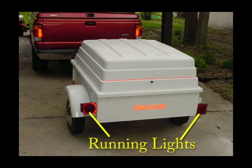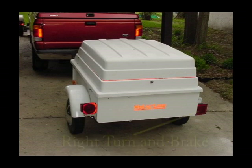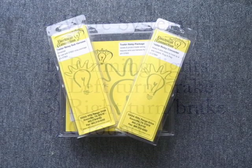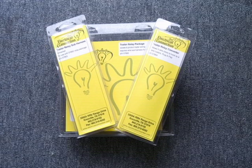Trailers that are imported, or a trailer that's designed for a car, may have combined brake and turn signals. For example, trailers from Harbor Freight and Piggybacker are 4-wire trailers — they have just one pair of lights on the back. This means a 4-wire trailer uses one less circuit, making it a little different than your bike. You can't directly wire a 4-wire trailer to your bike because you won't have a brake signal. So for trailers with combined brake and turn signals, you need the 4-wire kit. This includes the same components as before — the relay, the sub-harness — and a converter that takes your bike's 5-wire system and makes it compatible with a 4-wire trailer by adding the brake signal to the turn signals. These are all separate components, so if you get a different trailer later that is a 5-wire trailer, you can take this converter out and make your wiring compatible with the new trailer.